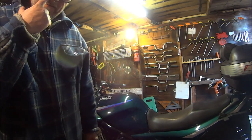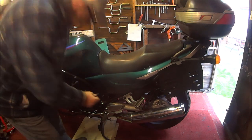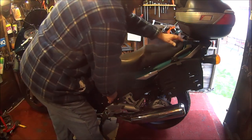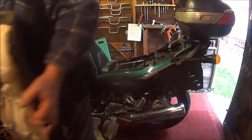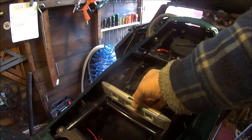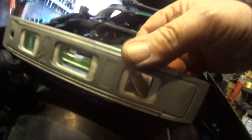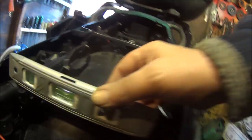So now make sure the bike is level. The way I do that on this bike is just take the seat off. Hopefully you've got a spirit level — just stick it across the crossbar, put it on the top frame tubes which should be level. If we look at the bubble it is a mile out, so I need to put something underneath this side of the stand. I found a piece of metal to chuck underneath it, and now it's just about bang on.